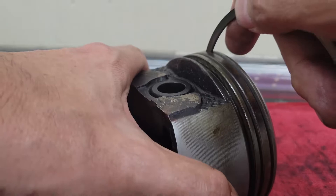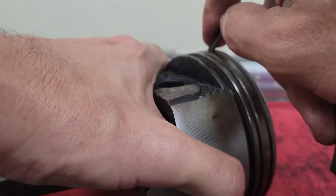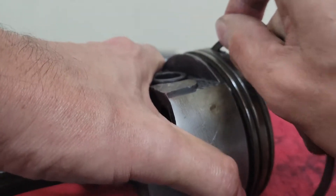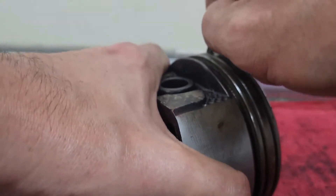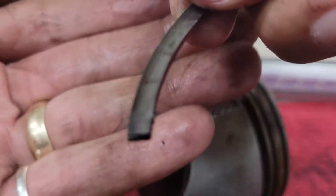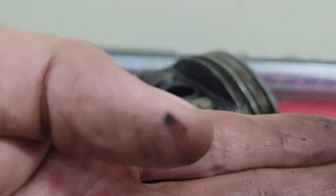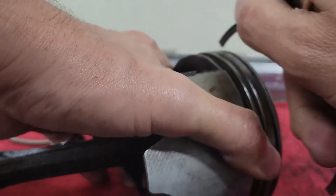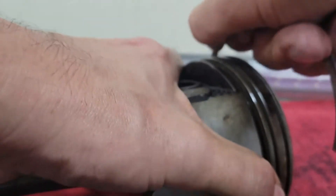You can see those black marks — that's carbon in there and we want to get rid of that. What I'm going to do is put the ring, the face of the ring, down in there and just grip it in there. You can go both ways. Look at this — this is just a couple of seconds worth of grabbing on that. And look, it digs it out so readily. It's just a no-brainer to use these things. If you're in your solvent tank and working this thing, you can instantly wash that off. You just rub it back and forth on there. Gets rid of all that carbon.